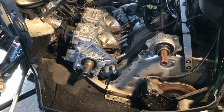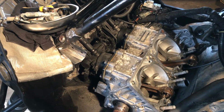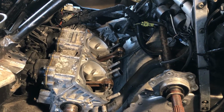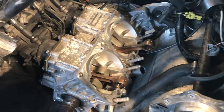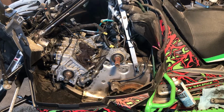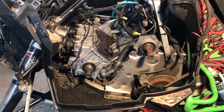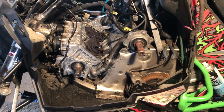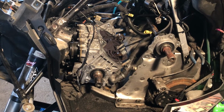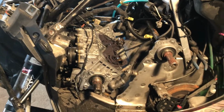And I can take that coolant line, drain the rest of the coolant out of the bottom end. Loosen the two throttle bodies off. The motor mount over there. Electricals, there's some little odds and ends. Motor mount down on the very bottom of the engine. Well, the engine's all ready to get pulled out now, but I can't lift it because I just had back surgery not too long ago, so I just gotta wait to get some help. Take it out, put it on the bench somewhere, and start putting everything back together.